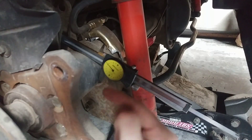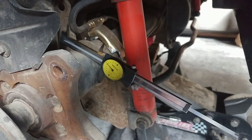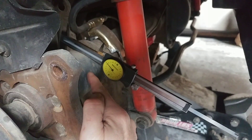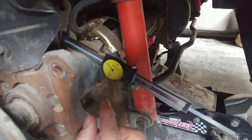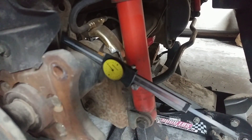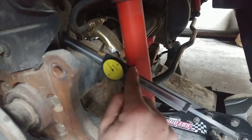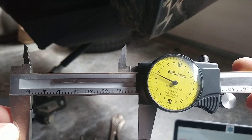The place you want to measure the OD is on the inside of your bracket — that's the OD of your housing tube. I removed the caliper to demonstrate it and get good lighting in there. I have two sets of calipers: one digital in millimeters and inches, one analog millimeters-only. The battery in my digital set is dead, so I'm measuring in millimeters and converting to inches. Measuring the housing, I use my stop to keep the measurement, pull it off, and find it's roughly 72 millimeters.